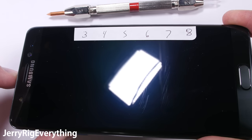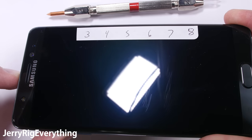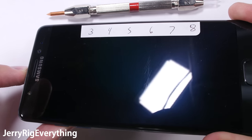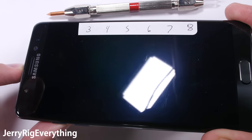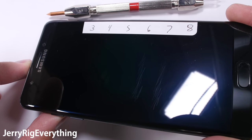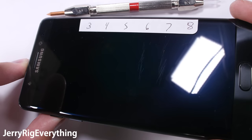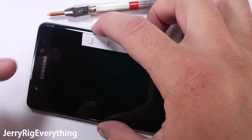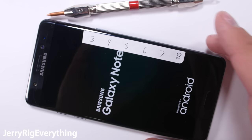My picks failed me during that first test, and in turn my results were skewed. The Gorilla Glass 5 definitely does not scratch at a level 3 as I erroneously stated in my previous video. Gorilla Glass 5 is the same relative hardness as other tempered glass screens, like Gorilla Glass 4. In the future, I will not be sharpening any of my picks with this stone — I'll just purchase a new Mohs kit when I need to.